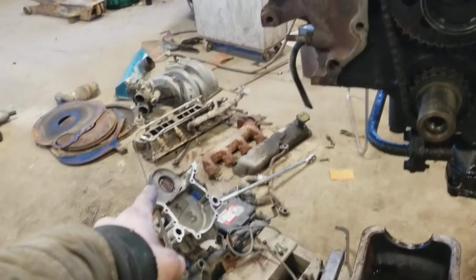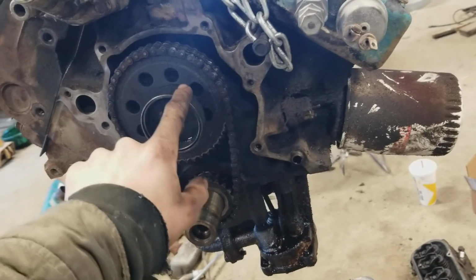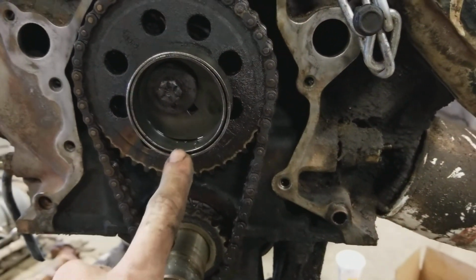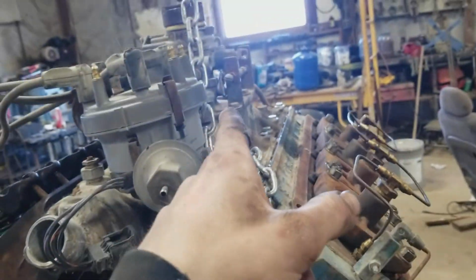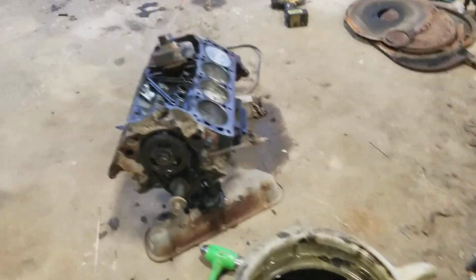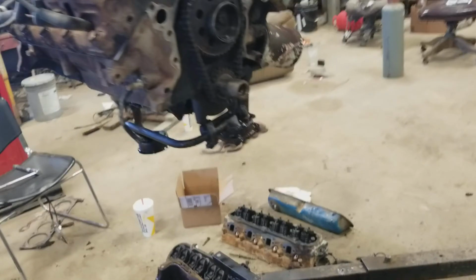Bolt that 70s one on the 90s motor after you've put this on there, because all that does is let the mechanical fuel pump ride on this, and see how it's offset from the center hole. When it comes around, makes the revolution, pushes that arm up and down, which pumps fuel to your carburetor. But if y'all was wondering about that, it's really simple. If you got a couple motors laying around, I'm sure most of you people running derbies like me have an abundance of supplies.